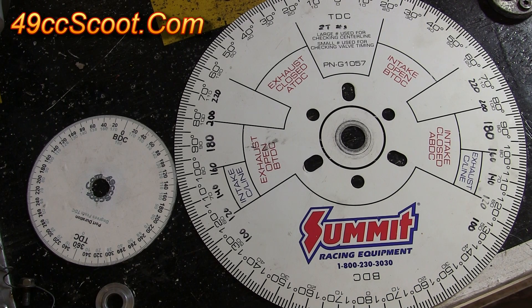In this video I'll show you how to set up a degree wheel. A degree wheel is used to check timing events such as cam timing — like when an intake valve or exhaust valve opens or closes on a four stroke engine — or you may use it on a two stroke to check port timing so that you know your port duration. I'll be showing you not only how to install the degree wheel but how to zero it on top dead center, so you know what true top dead center is and when things are happening relative to crankshaft angle.